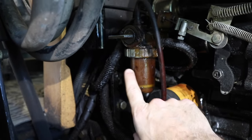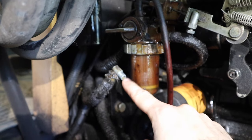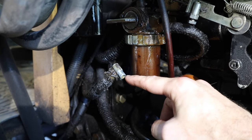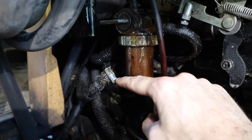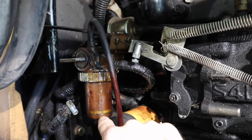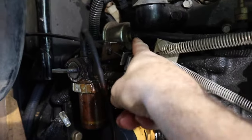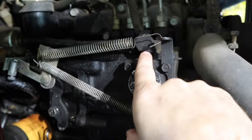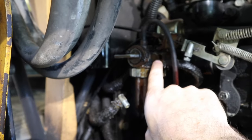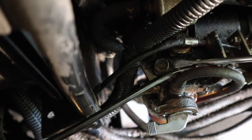Here's our fuel filter assembly. Here's the line in from the fuel tank — this is the hose that shot straight out of the assembly and it's got this little lip on the fitting. The entire tank drained because I could not get this put back in; that little lip holds some sort of seal and that deteriorated. This hose here is the outlet and this whole bowl is full of fuel, so I'm going to clamp this off. Here is the inline filter — it comes over here to the injectors, and I believe this is the final point where I would have to bleed it. This whole assembly on some tractors is connected by that bolt hole, but ours is connected right on top through the bracket.